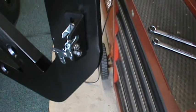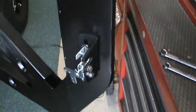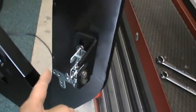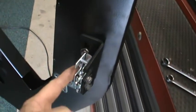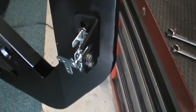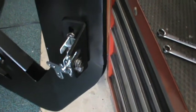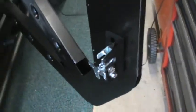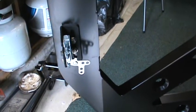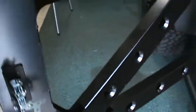Before I paint, I'm going to pre-fit the latches on the door to see how they fit. On these doors, the handle is always in the bottom. On the right door, the latch itself is on the inside and the bracket is on the outside. They use two different types of screws — half inch and 7/16. And after it's adjusted, this is so cool — closes that easily and absolutely no rattle whatsoever. And this is the driver's door, the left hand door. You can see how it's a mirror image, and this also closes very nice.